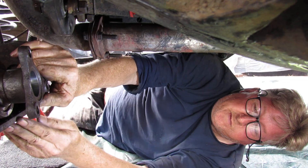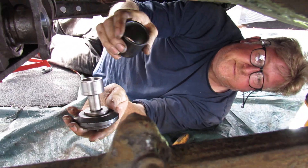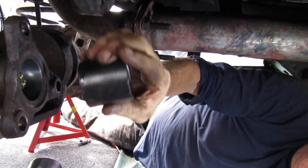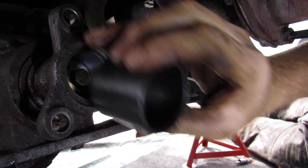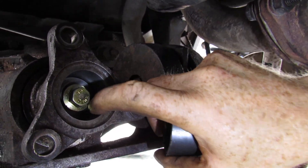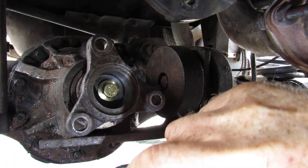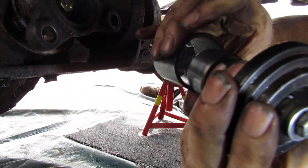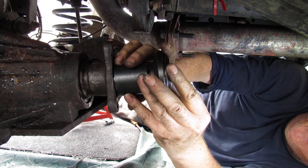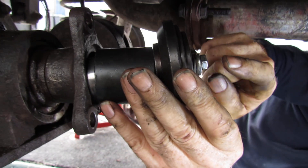To get the centering pinion out, what we used was a G-clamp ball joint removal set. It's one of the smaller cups — the one that fits in the recess, bigger than the pinion. Bear in mind it lives in there and goes all the way to the bottom. We placed the cup on top, put the cap on, and put an 8mm bolt into the top of the centering pinion. With the appropriate socket — I think it was a 13 or 14mm — we literally turned it, with a couple of nuts and washers underneath to stop the bolt pulling through, and just turned it out.